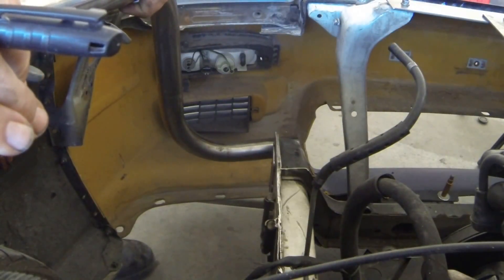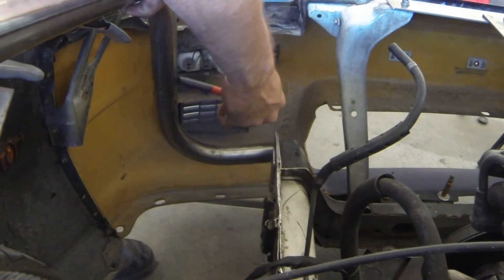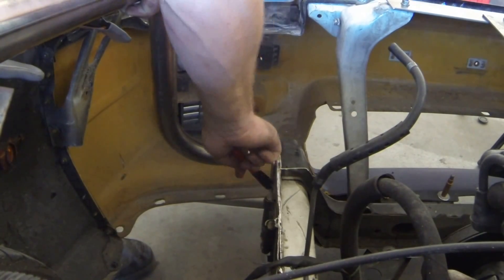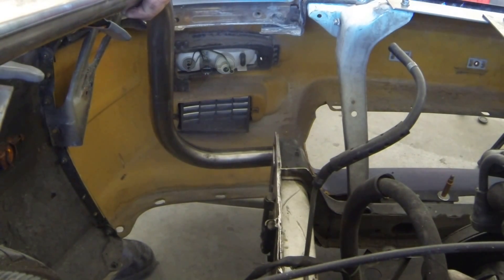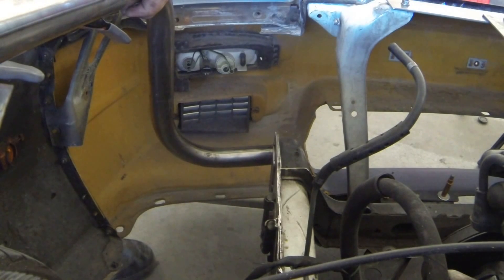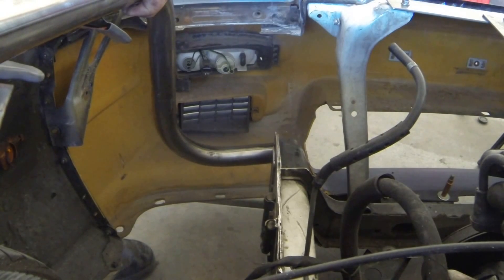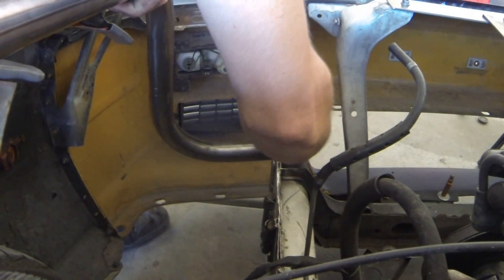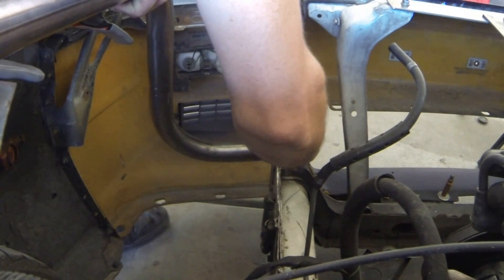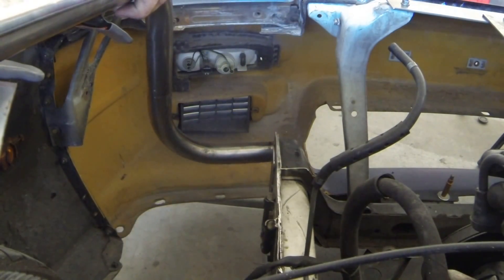With my dimple dies setting the correct amount of spacing, I need to make sure this section of the tube is parallel with the chassis rail — these two need to be parallel and as equal as possible. You can use your eyeballs, but it's best if you actually take a measurement. I did this off camera to make sure I had it correctly and already marked it, but for demonstration we're going to hold it up in place and make a mark right at the point and angle at which it needs to be cut. And that's where I'm going to cut it exactly like that.